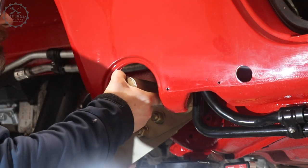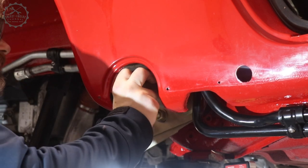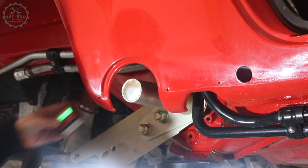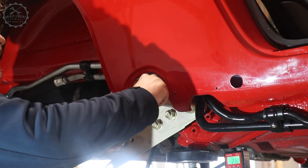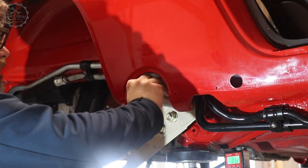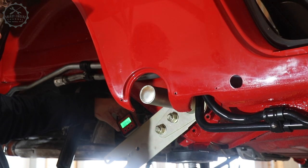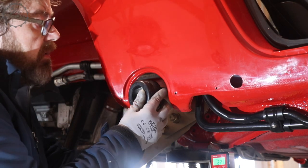The sprockets of the torsion springs have 48 teeth, which means shifting them by one tooth allows you to turn the sword by 7.5 degrees. As the teeth of the inner and the outer sprocket have an offset, flipping the spring gives another factor of 2, i.e. about 4 degrees. Marcus told me that 32 degrees towards the ground are about right. That is the way I put the car together now, and some fine tuning can be done later on by means of the eccentric bolt we've seen before.